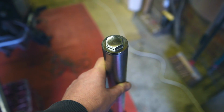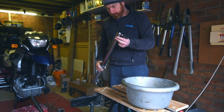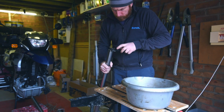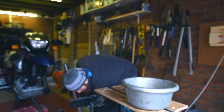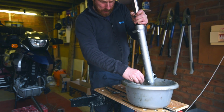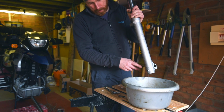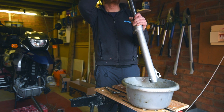And there's that 24mm nut on the top there, you just have to slacken off. So now I've got the right hand side fork, and I'm going to slacken off or completely remove this top bolt now. Bit of a spring load to that, so be careful when you do that. And a 10mm. So what I've done just there is 10mm socket, and there's the oil drain at the bottom here. Careful though, everything wants to just kind of slide down itself.